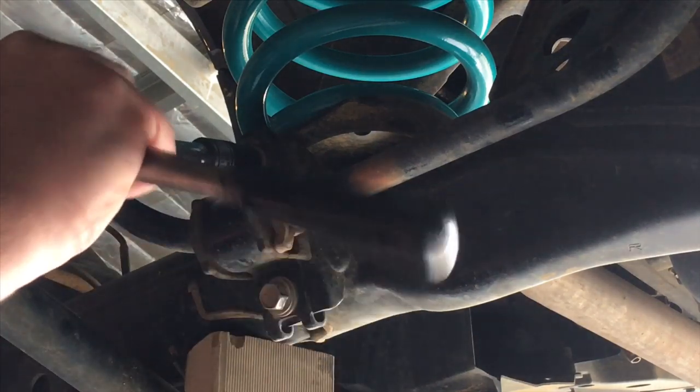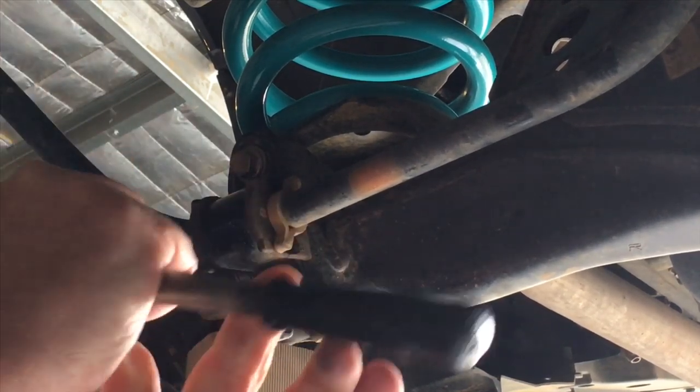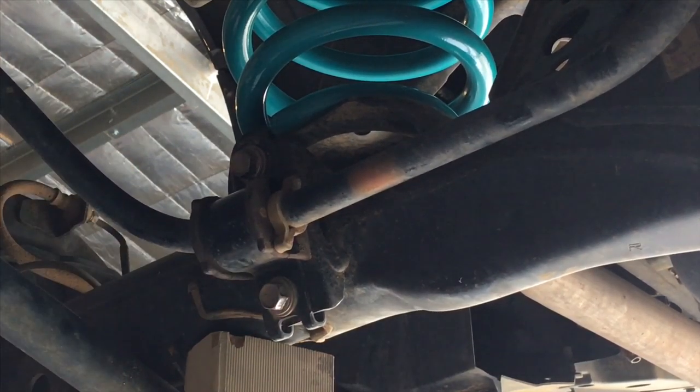I don't care with the extension or not, right? Just check it. Yeah, they went a little bit more, but that's fine. And then you can say, well, I did okay with the rattle gun or the impact wrench or whatever, but not on the highest setting. If you go hard enough on the highest setting, you rip bolts and threads and all sorts of things. People like to go on, oh, yeah, the rattle gun.